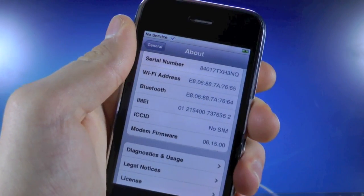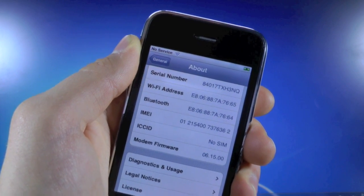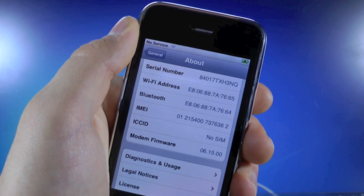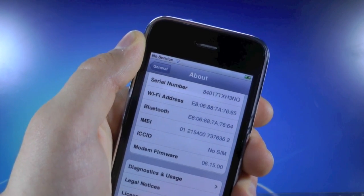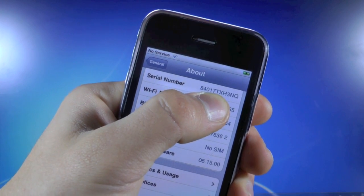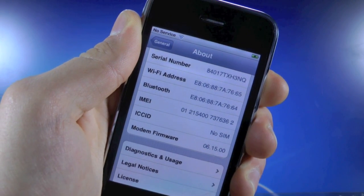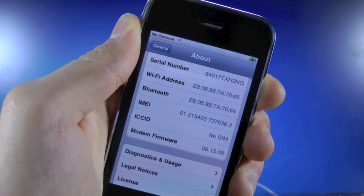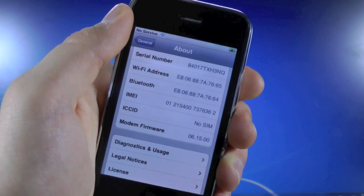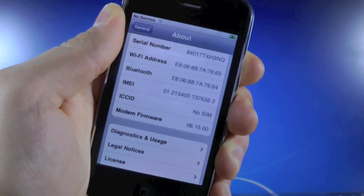These numbers represent the year and the week number your iPhone was made on. You want to make sure your iPhone was made on the 35th week of 2011 or earlier. The third number is the year your iPhone was made in — for me it's 0, meaning 2010. If it's a 1, that means 2011; if it's a 2, that means 2012; and if it's a 9, that means 2009. The fourth and fifth numbers represent the week number. So for me, that's 17, meaning the 17th week of 2010. If your serial is something like 136, you are not compatible — you're running the new Toshiba baseband, which will not work with this unlock and will brick your iPhone. If it's something like 201, that also will not work. So you want to make sure it was on or before the 35th week of 2011.